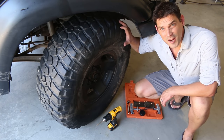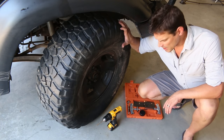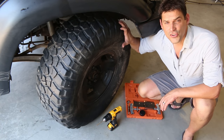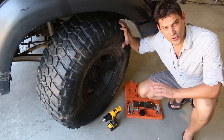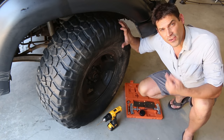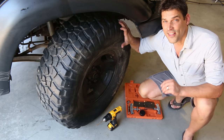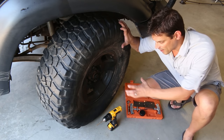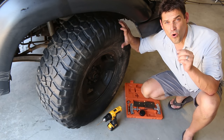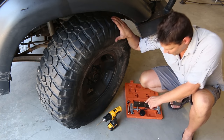I've basically set up a laboratory environment here — it's not going to be like this when you're out on the trail; it's going to be messy and not ideal. With this kind of repair you want to do it with air still in the tire if you can. If you're going down the trail and you hear the puncture, move relatively quickly. As that hole goes around you're going to hear a sound. When you can really hear the air, that's when you want to stop — you know it's not going to be buried against the ground or mud, it's going to be open, and you use the sound to locate the hole.